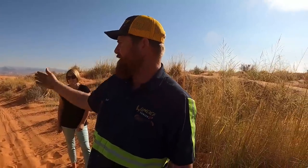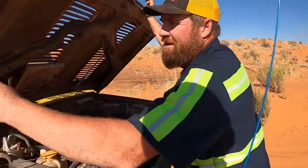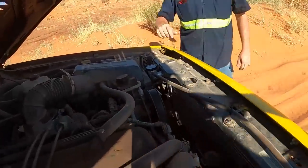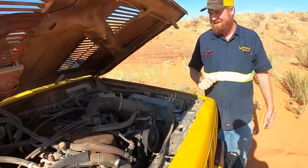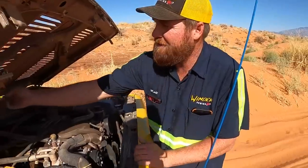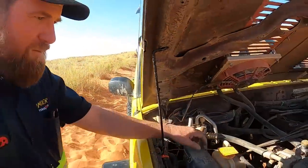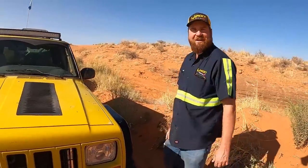It's not really overheating — it's not boiling over, it's just running. Since there's no electric fan putting air across the fuel rail, it's actually vapor locking. This whole side of the radiator has no fan on it, and that's making the fuel rail run extra hot. All the heat from the manifold is coming up to it, and that's why you can hear it missing when I'm idling. This fan only kicks on when the AC is on, so that's not working. We've got to take it in the shop and figure out some more stuff.